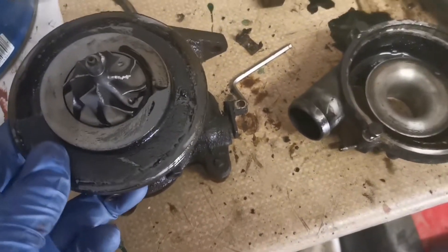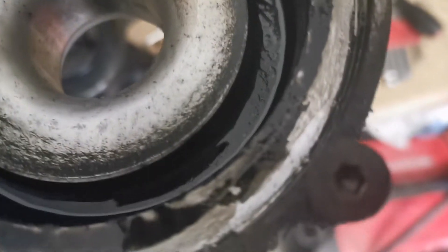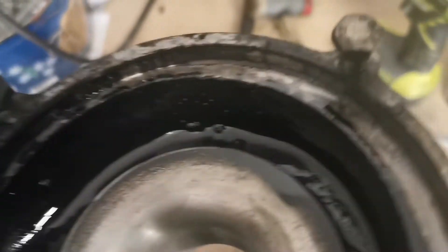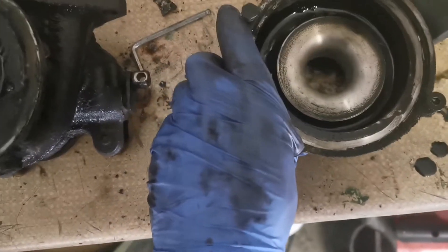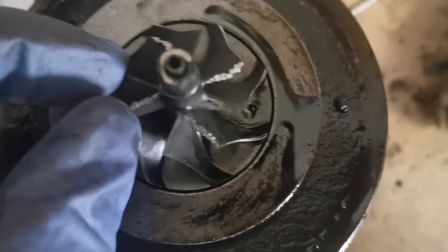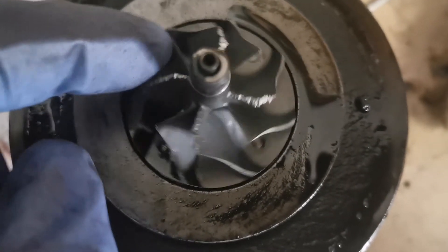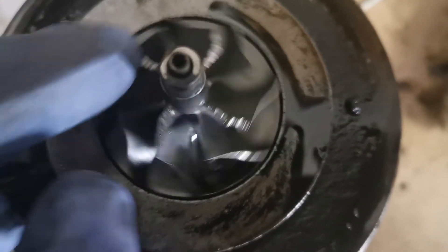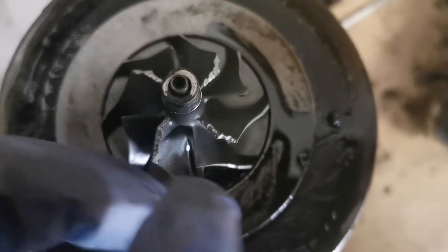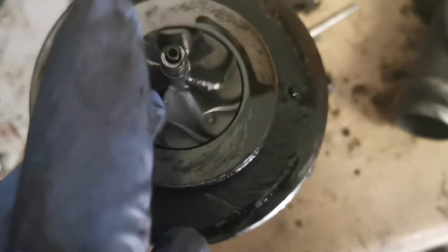I have the compressor shroud off now, and there it is. You can see that the damage is basically limited to just the inlet there — around this edge here — and that should all dress up. I'd say that'll look pretty good by the time I've gone around with some very light emery just to take the rough look off it. Interestingly enough it's also full of oil, which would say to me that one of the seals in this turbo was gone as well. Just as well we're doing this job, because even if this turbo hadn't eaten something — which it certainly has, as you can see by the blades — it would still be giving rise to a smoky engine that's consuming oil, and that just wouldn't do in the context of a freshly installed engine. The next thing to do is to take the turbine plenum off, then get everything cleaned up and start putting it all back together again.